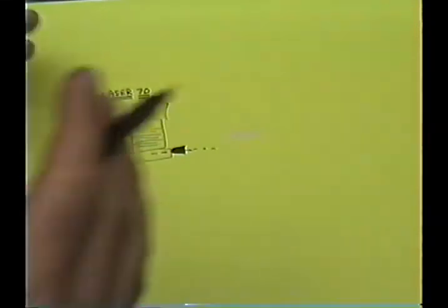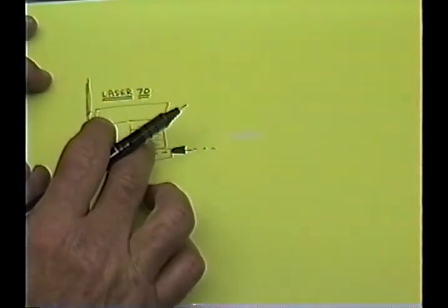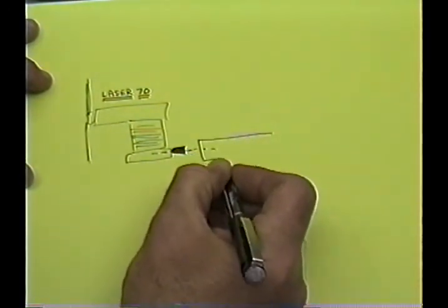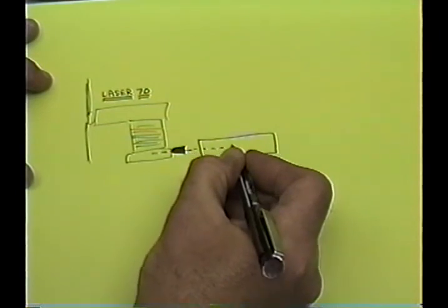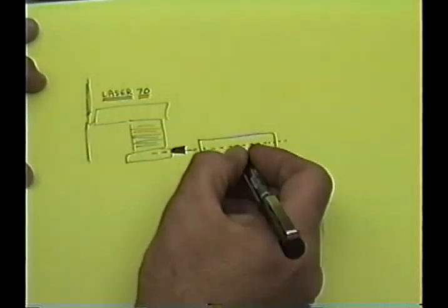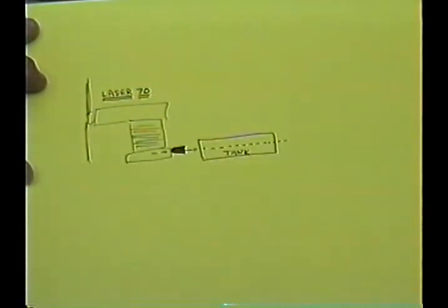What that meant was, if you were running this in an RC scale plane, it wouldn't even matter, because you could put the tank in various places, and that's what this engine is made for. But after going back and forth and shimming it too far in each direction, we found out absolutely positively that the center of that carburetor, where the needle valve is, seems like it wants to be right on the tank center line.